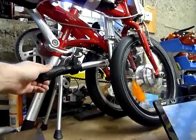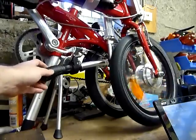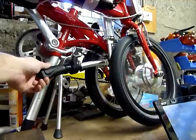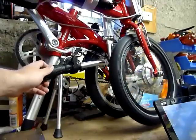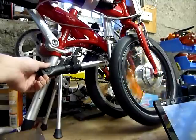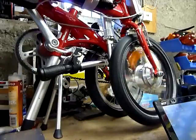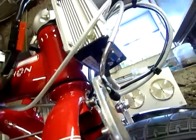In this situation, you have seen that I have reached the max torque and the max speed. Remember that the Kelly KBS is a sensor-read controller. It reads the speed of the motor hub. So if you use the twist it is not regular, because the hall sensor is used even in the freewheel setting. So the twist is not logical for a normal user. But for me, it's a good reaction. And it's all. It's the Kelly KBS system and programming part.